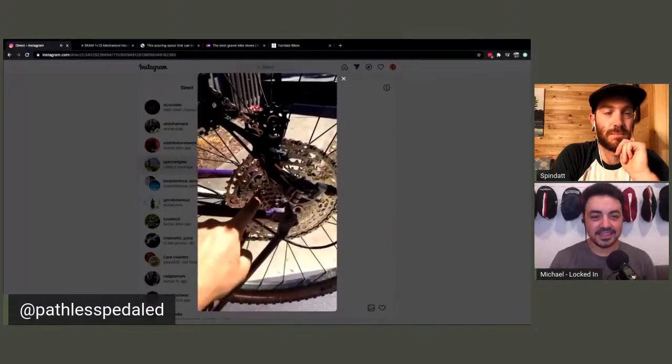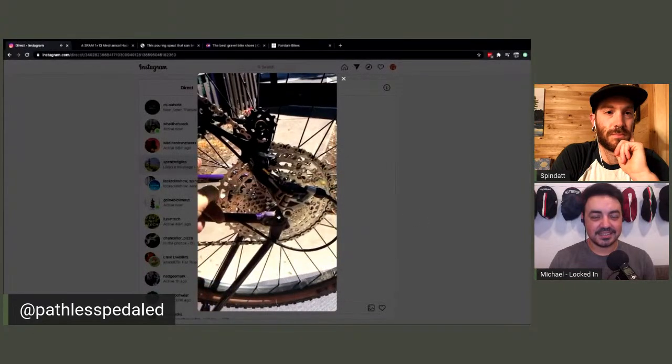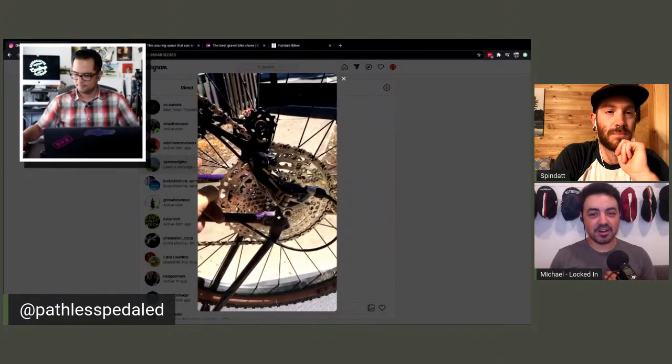Yeah, Shimano 11 to 50. I had my buddy's Fargo, and we had an 11 to 50 on his Rival. I have a video on that, and it worked, and it still had some B limits, so I could see a one tooth difference working with that. But yeah, it shifts. The Garbaruk or a Roadlink does help with strain on the derailleur at the limits. But yes, physically it will go into gear.